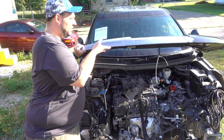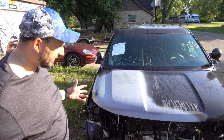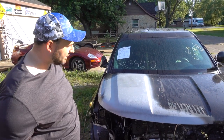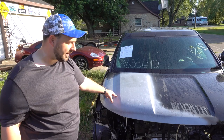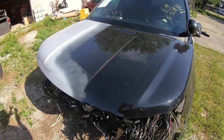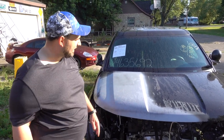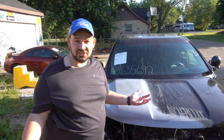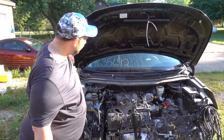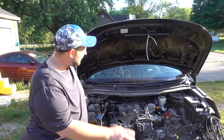One interesting thing: you can tell from this hood that they didn't total this thing at first sight — they actually did start a disassembly. A lot of the parts are in the back, some removed before the accident. You can also tell by looking at this hood they actually started to repair it — they fixed the fender on this side, the hood is straight and they primed it. So I'll probably have to reprime and sand it since the whole thing is going to be painted. They were obviously thinking about fixing this at one point. Not sure if the hood hinges are good — it may just need to be straightened or I may need new hood hinges. I'll investigate that more closely.